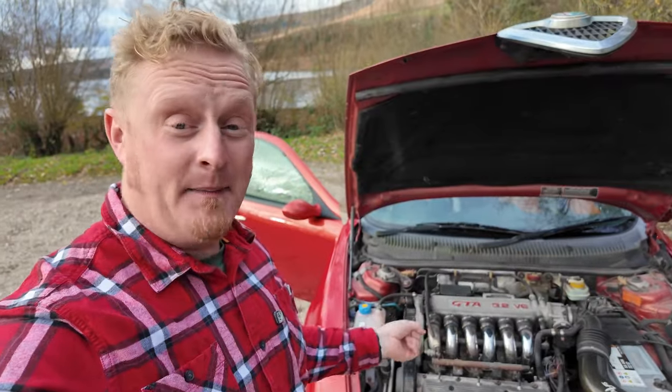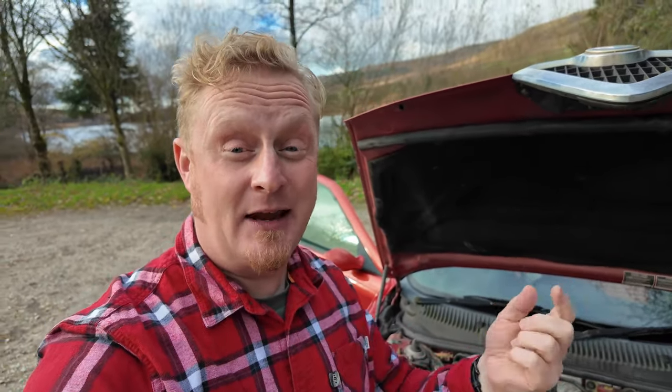Something I did know about but had forgotten is the oil leak on this car. Yeah, it's an Alfa — it does have an oil leak, but it's not a very big one and the MOT station did pick it up. I think I know what this is: according to the history, the sump plug had been replaced with a tapered one. It looks like someone's messed up the threads on my sump plug, meaning oil is leaking from the plug regardless of how tight it is. This might mean another sump plug is needed, or perhaps a new sump — but it's an easy fix, only leaking a tiny bit, and just one to keep an eye on.